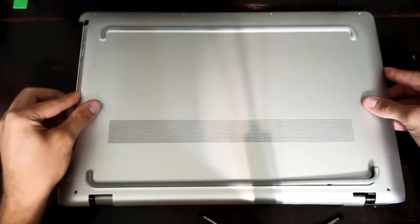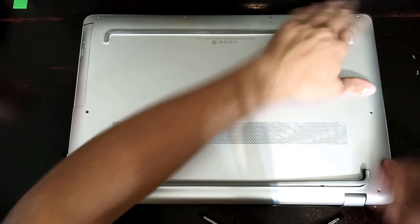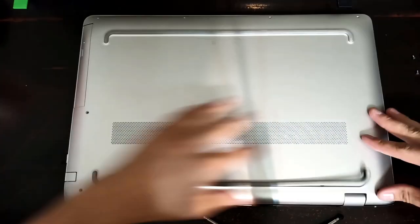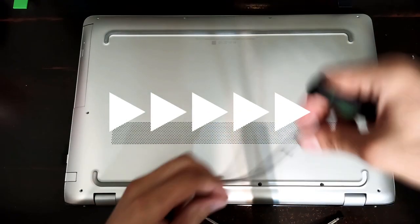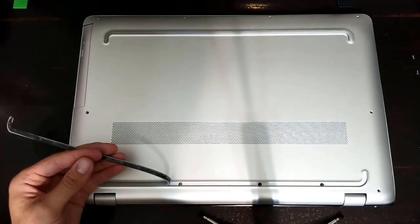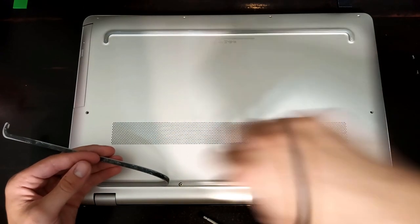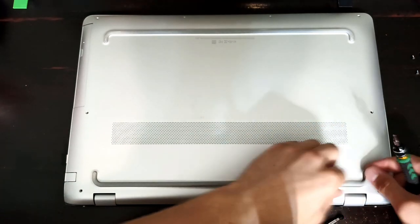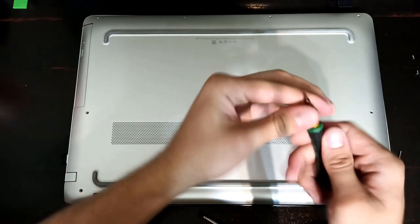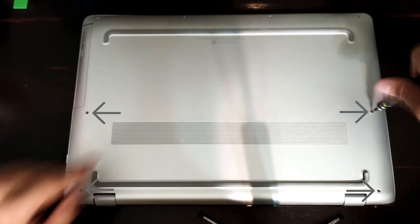that was ominous. I'm gonna go ahead and put the case back on. I'm gonna be optimistic and go ahead and put the screws in and give it a quick test. Put these Phillips ones back in. I'm not going to completely stick that rubber back down yet in case I need to get into it again. And then switch to your T5 bit. And remember, the long ones are these 4 here.